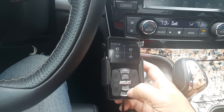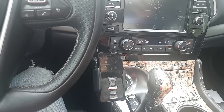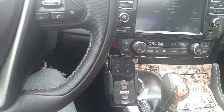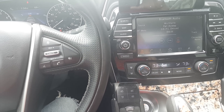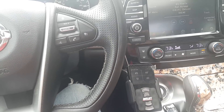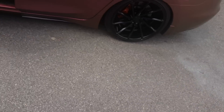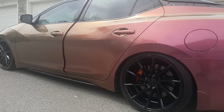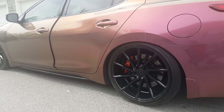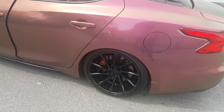Here's my current ride height — very simple air suspension. It goes up and it goes down. The bags are set up with adjustable dampers, so I can go a few inches above stock height or drop down. I'm on 20s so it's not going to lay frame or tuck the way it's set up. I'm getting an alignment next week — I'll probably raise it maybe an extra inch front and back before that and work out what feels comfortable for everyday driving.